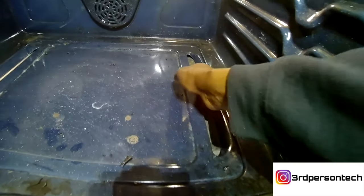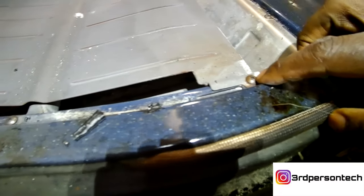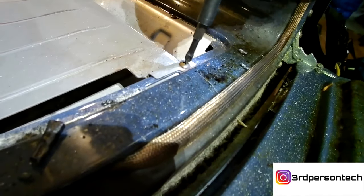Once you move those two screws from the back, you're gonna take your hand, stick it into the space right there, and just pop that panel right out. You lift it up at the back first and lift it out. Now we have — I think these are also Phillips head screws — holding down this cover that's covering the burner. Remove those screws; make sure you put them where you can find them.